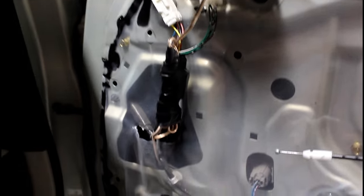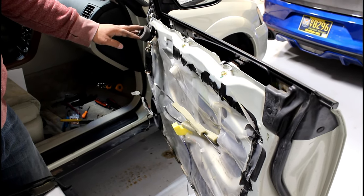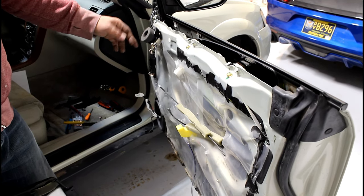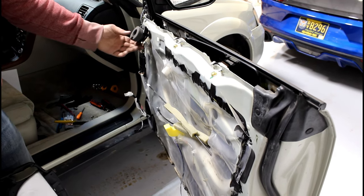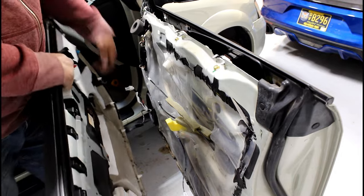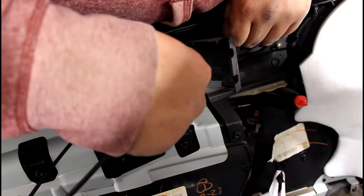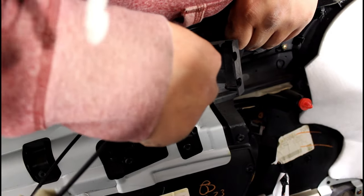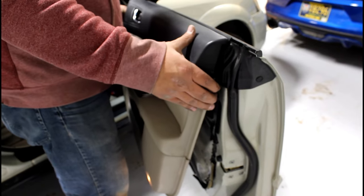Let the tweeter dry, take off the tape, then you can put the door panel back on. I put the little foam ring that came with the components around the tweeter just to seal it against the door and maybe stop some vibrations. Now put the door back — push the cable in here, once you get the big ball in the bottom the little ball goes on top. Push it in and shut the door — hang it first.